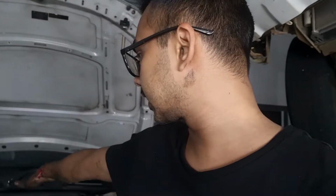Okay guys, the situation update is this. I removed all of the undercovers, I removed the downpipe, and I removed everything else I can see from the top. However, I do need a 12mm 12-point socket to remove the turbo off the manifold. Ironically, I have that at home, not in the workshop. So I'm about done for right now, as much as I can. We'll pick this up for you guys in the next couple of seconds, but for me in the next morning.